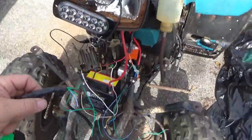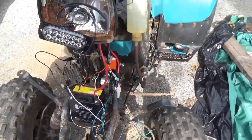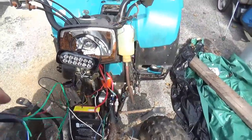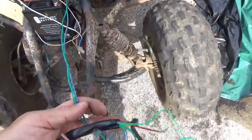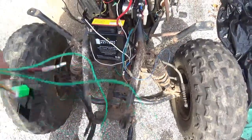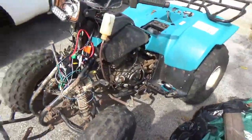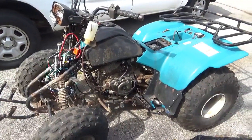As you're laying out this wiring, you really want to make it as neat as possible. The problem is I'm wiring it now, and when I put the fender on I might have to take some of it apart again, put the fender on, and then run the wires. So make sure you leave yourself plenty of length. Right now we want to wire it up and get it started, then after that we can go forward and make it all neat and pretty.